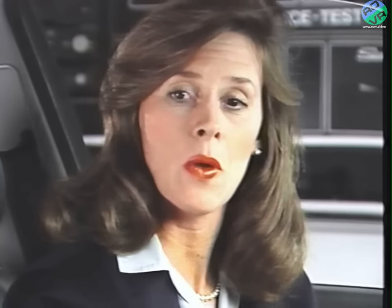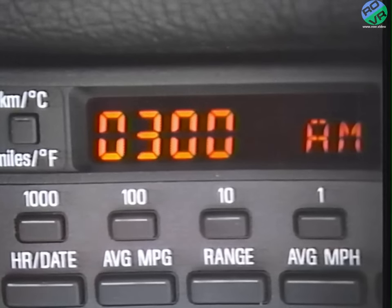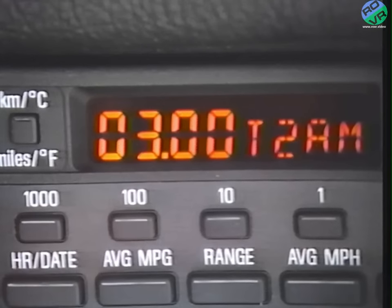That I didn't know. This is used on warm days to program the ventilation system to kick in when the car has been parked for a while. Before going into an appointment, press the timer button twice, input the time, press SR. And if I'm not sure when I'll be finished, I program in a second time to make sure the car is comfortable when I get back. Turn it off by pushing SR if I get back in between the two settings.